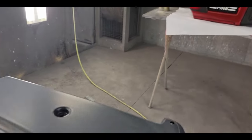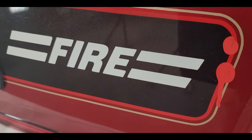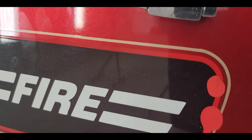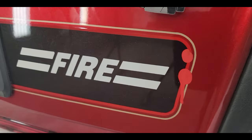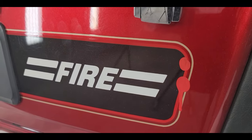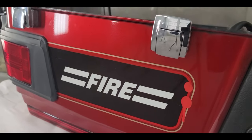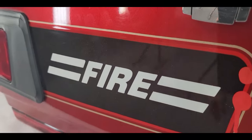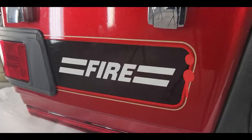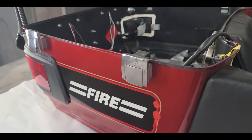The plan of attack is to do the gold stripe first, then stripe it at a sixteenth inch, then do the orange-red stripe and put an eighth inch on that. I'll use the sixteenth-inch guide in between to get the distance between stripes accurate. Then I'll do the black merlot, then the ember red sunglow, and pull all the tape off — only two pieces of tape. I'll also have to mask the merlot area, but once that's done I'll pull the paper off with the pinstripes still covered, spray the ember red sunglow, and pull those two pinstripes off. That's all the taping needed.